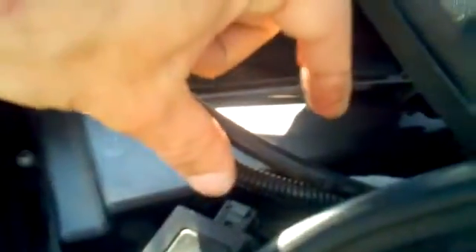There's a little black box in here with a set of fuses — you'll find a fuse in there that's open. That's going to need to be replaced along with the thermostat, and you're going to have to put a new connector end on the thermostat plug for the MAP portion. I've seen a few engine control units or DMEs needing to be replaced because of coolant wicking up and corroding the pins. That engine control unit needs to be programmed with a new unit — you can't use a unit from another vehicle or from a junkyard because they are married to the vehicle and are VIN specific.